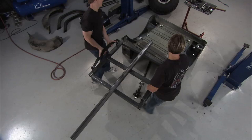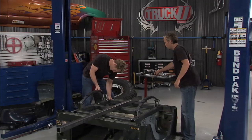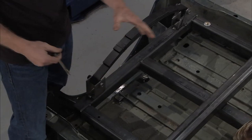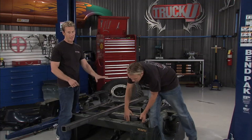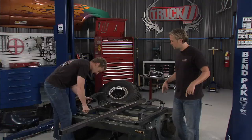Now we're ready to see the fruits of the labor as we start putting these big pieces together. We've got the frame of the trailer kind of buttoned up to the body of the trailer — it's starting to come together. At first glance you might notice the frame looks a little bit wide because it extends beyond the fender wells a little bit, but there's a good reason for it. This thing's going to have some height to it and a high center of gravity, so in order to keep it stable out on the trails we went a little bit wider with the springs. You'd be surprised how much a few inches can make — big difference. Now we'll get those bolts into place and we're ready to set this axle down too.